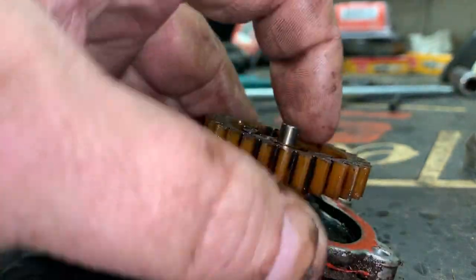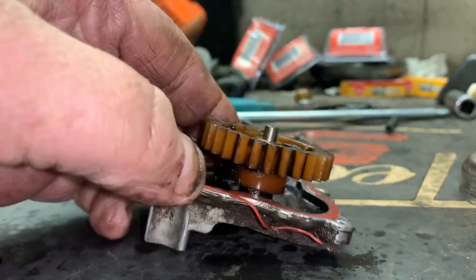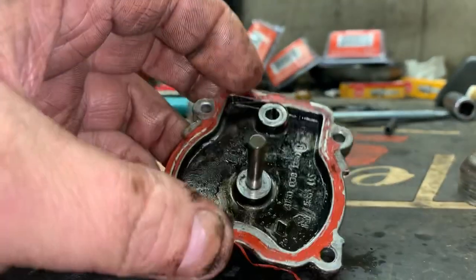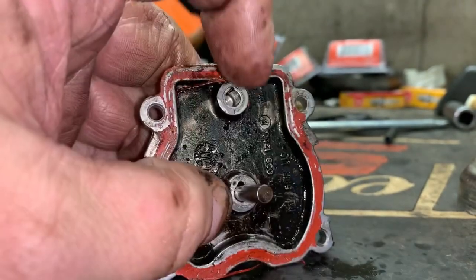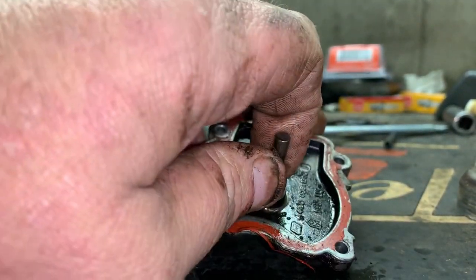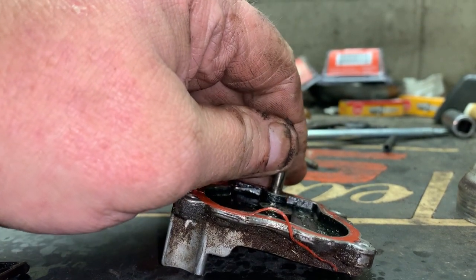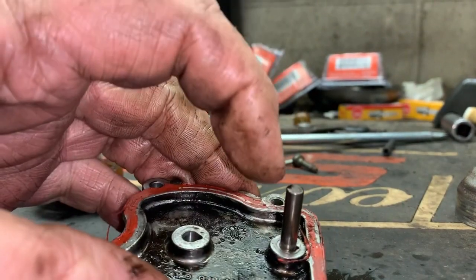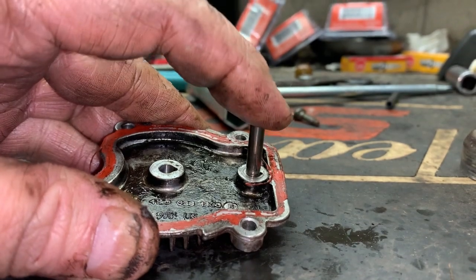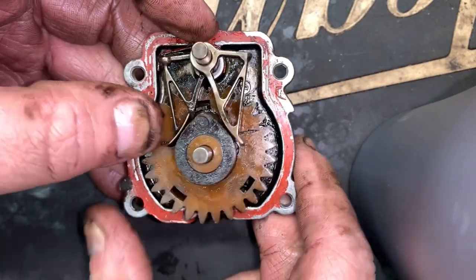You shouldn't have any play right here, but this is not the issue. Where this camshaft lives inside the motor, you have a back cover on the back of the engine. This cover wallows out from use and heat. The boss where the cam rides is okay, however where the two rocker arms mount — let me show you that boss.